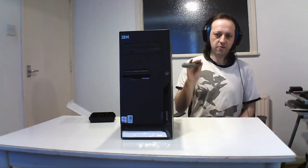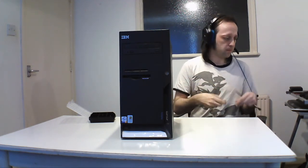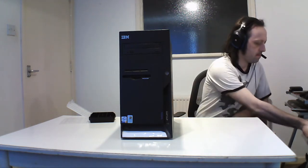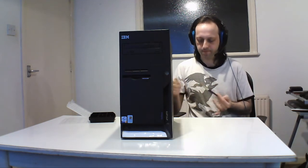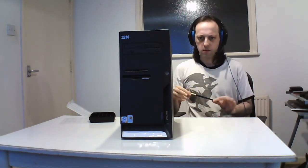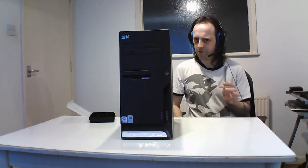I've got a smaller drive that I normally use for laptops because it's easy to get into the bay, and it has a magnetic top. I also use a brush. This is a non-static brush, and I normally use it for getting into small details like fans and areas I can't get to, and this doesn't damage the hardware. It's easy just to brush a couple of things off, and I always use this and have no issues.